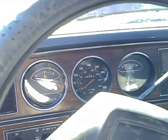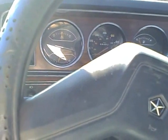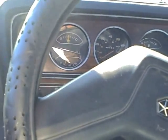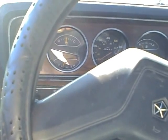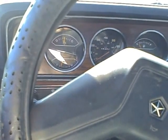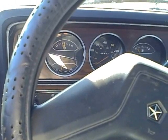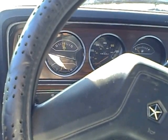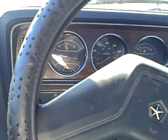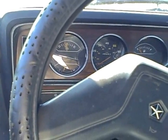This one is mostly for you to hear the idle. We are making a little bit of progress here. The blower is off and I am able to very slowly increase the idle speed. If I do it too fast, it'll speed up but it'll die. But if I do it real slow, it seems to be able to handle the increased speed and then eventually maintain it. It's getting a little bit higher — I'm doing this a hair at a time. It's also surging just a little bit, and when it gets to surging, it dies.